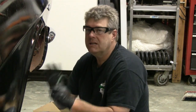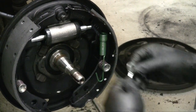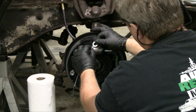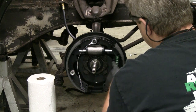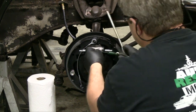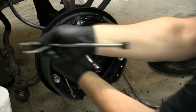The way I do this may be different than the way other people do it — I know that Cam did the other side in some odd, bizarre way. What I do is I'll put this front spring on and set it aside for a second, then I will install the wire which goes in the very back. When you put this wire on, make sure that this is pointing up. There is a tab system with the way they put this together, and that should be pointing up toward the hook. Put your green spring on first so that you get a better set out of all this. Take your brake tool, lay it over, push it up against there, and it's set.